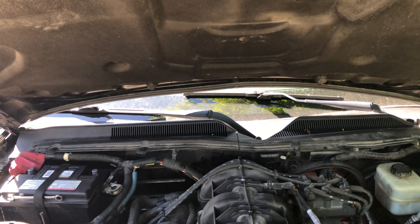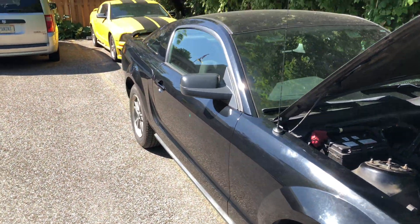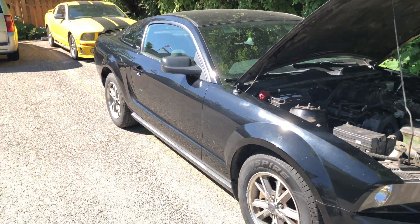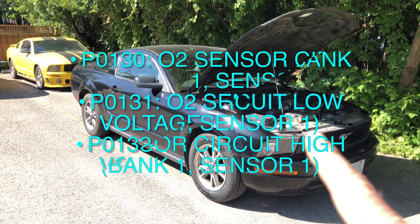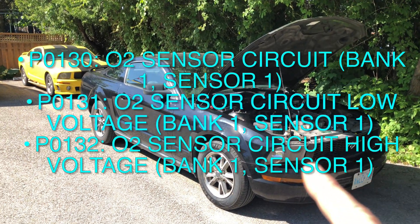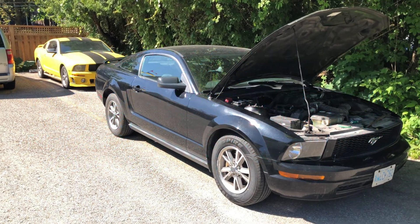If you've got electrical problems, you've already replaced sensors, and you've still got issues, this is going to be the number one place I would look. Also check your grounds on your vehicle, because all those things will still throw that code even though you've replaced the sensors.